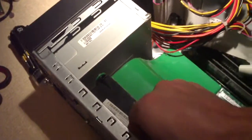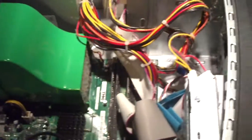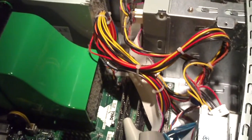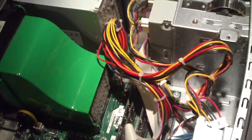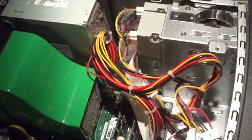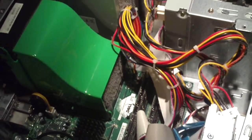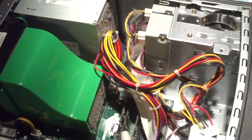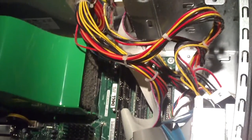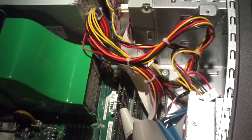It's not hard at all to just keep your computer cleaned out once in a while. At least every other month is probably a good schedule. All you need is either an air compressor with a blowing attachment, or you can go to your local Walmart or any electronics supply store and pick up a can of compressed air — it's an aerosol can with a little straw on the end. You can use it to blow out all the dust, which I'll demonstrate here in just a few minutes.